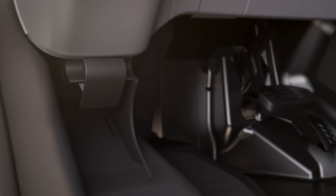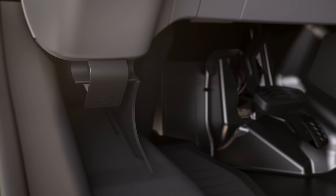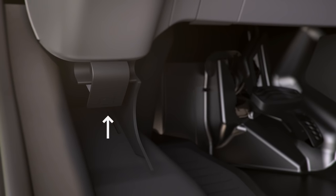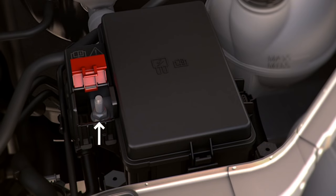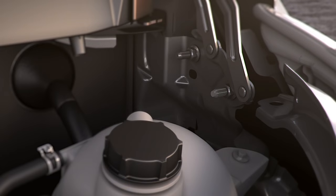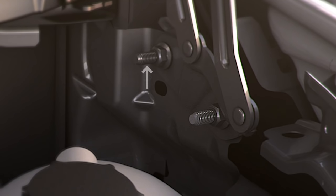Open the engine hood by pulling on the hood release located under the storage bin next to the driver's side door, here. The battery jump box is located on the driver's side of the engine compartment. Lift up the red access panel to expose the positive battery post and attach the positive end of your jumper cable to it. Now connect the negative end to the ground located on the inside of the driver's side fender, here.